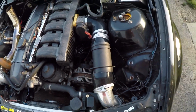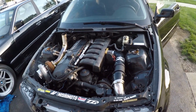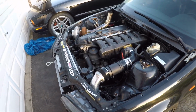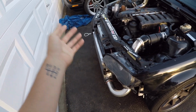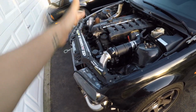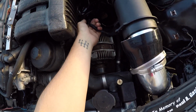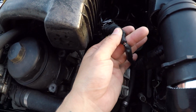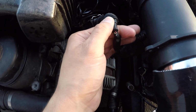Pop up. Fix it. Get a little bit down the street. Do another. Starts misfiring like crazy. Pops up again. Okay. Put it back together. I guess some water collected in the turbo and the intercooler while I was sitting, and when it rained, it wasn't much, but it was enough. I think I either killed the MAF or it broke the harness, because the conversion harness is new, but that's supposed to be sealed. This is like 100 psi strength sealing, and pop, this open.